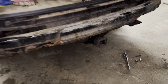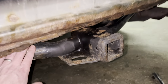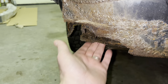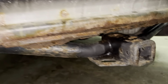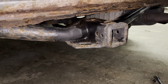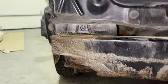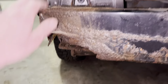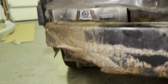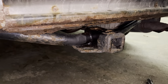I'm going to clean that all up before I start working on loosening the hardware to the bumper reinforcement. My hitch mount down here is actually covering a lower bolt that I need to remove. This hitch is held on to both sides with three 19mm bolts, so I'm going to get those off right now. Once I do, there's a 14mm bolt and a 17mm underneath that I'll get to as soon as I remove the hitch.